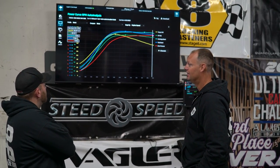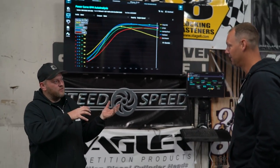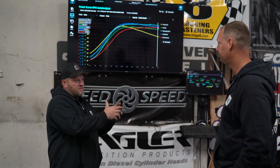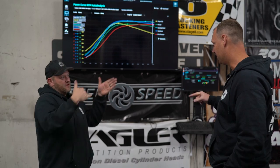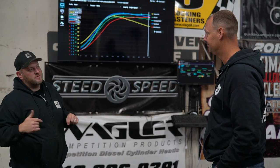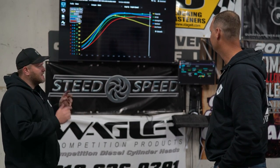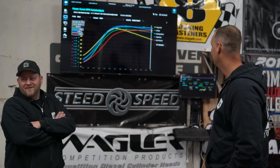So we're getting more out. More's coming out. What that's telling me, because the drive pressure is measured in the manifold, is the restriction wasn't the turbine wheels on the turbo. I mean, some of it is, that's why the drive pressure is there. There was more restriction in the head, because now that the head flows better, it's down to the turbos. There's more pressure backed up in front of the turbine wheels. Exactly. So the turbos are definitely driving harder. I'll bet you if we had a turbo shaft speed sensor, the turbos are spinning faster. We're moving more CFM into the motor, but it's making less boost because it's getting through it better. But wow, so 965 horsepower.